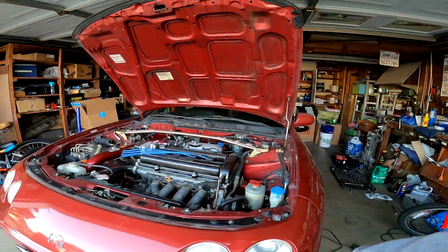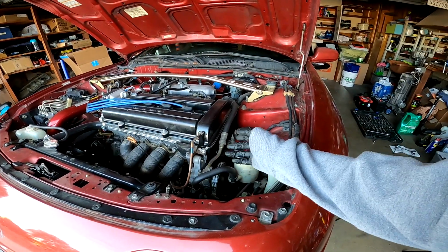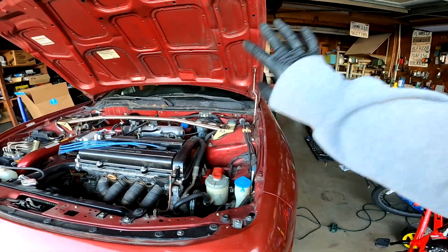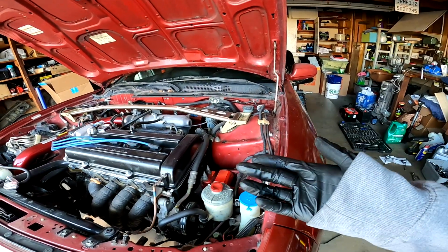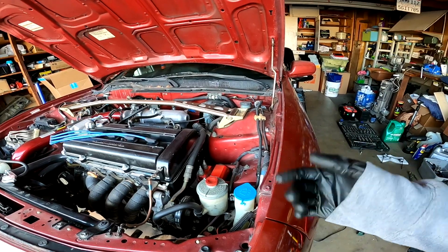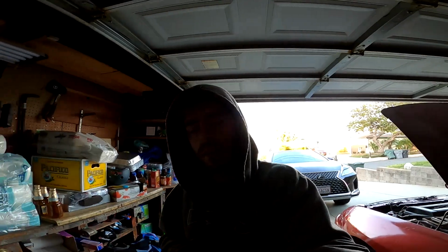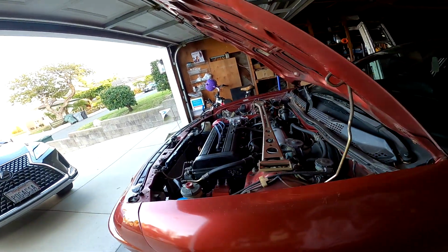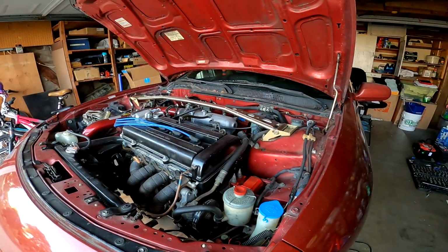Right now what I'm thinking, I'm gonna delete my power steering, because that's a simple one. I just have to get a fitting, take off the pump and all the accessories from it, and then on the rack what I'm gonna do is change out one of the fittings, put in a quarter fitting from the pressure line, and then I'm just gonna loop it. I gotta be kind of cutting back. I know I wanted to turbocharge it, but the problem is, first I gotta make money in order to modify these cars, and before the EPA bans everything.